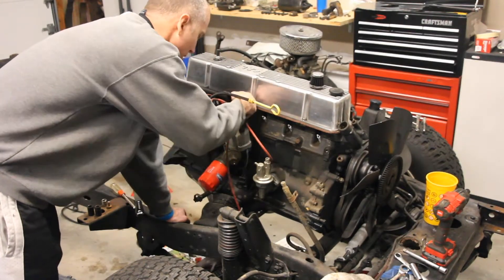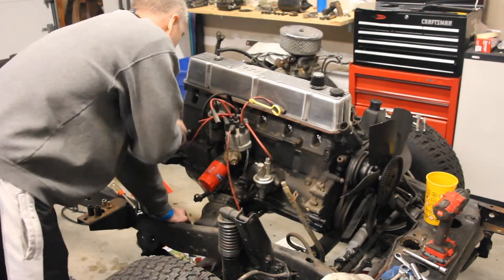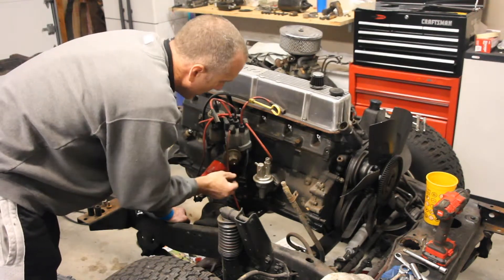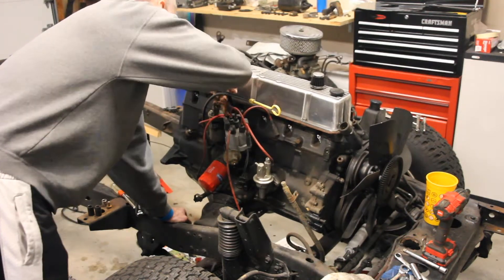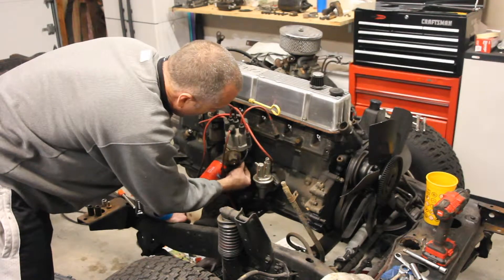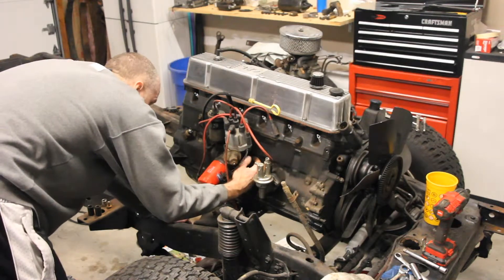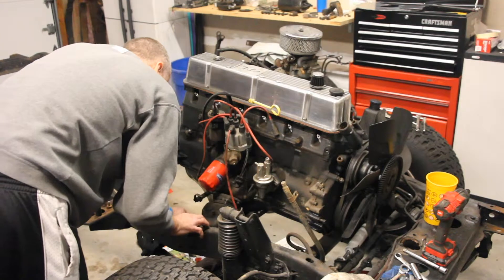As you're pulling out your cords, don't worry about it too much because they obviously all sync up to your distributor. So once you get those out and you've disconnected your coil, then there's one support nut and bolt down underneath here that holds in a support tongue that presses the distributor down into the engine block.